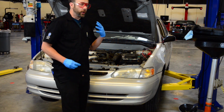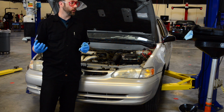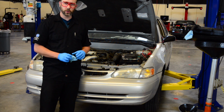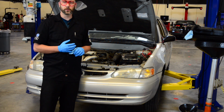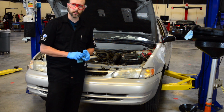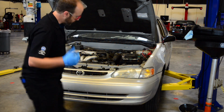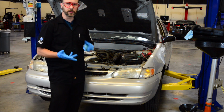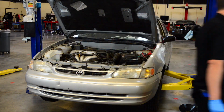Then on an oil change, you're going to have an oil light come on in the dash. That's the oil pressure light. You should get pressure within 3 seconds. If you don't, you need to shut the vehicle off and find out why you're not getting pressure. Something's probably wrong. If the oil pressure light goes out within 3 seconds, step out of the vehicle or have your team members look underneath and on top to make sure that everything's in its place and we don't have anything leaking or dripping on the floor. Let's go ahead and do that.